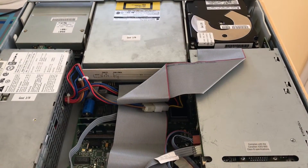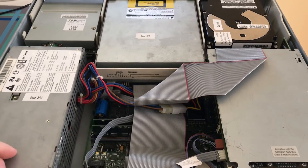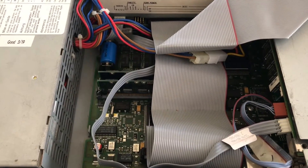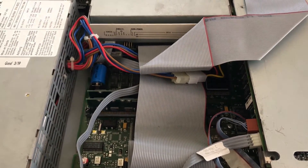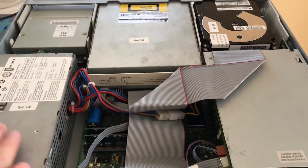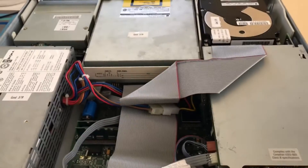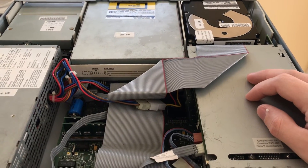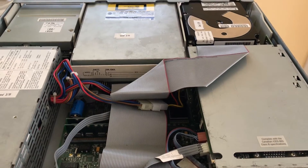The inside of these machines is fairly cramped. I actually restored this system in March of this year on its birthday. It got brand new capacitors, which I soldered on myself. I replaced the CPU cooler and put heat sinks on various ASICs so it could run a bit cooler. These run really hot just because the thermals are bad — you have a really hot 486 sitting directly over a really hot PowerPC 601 and there's just not enough fans.